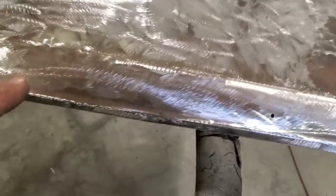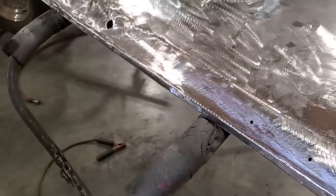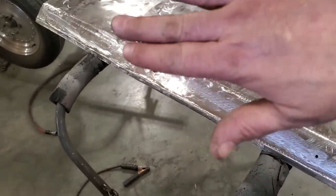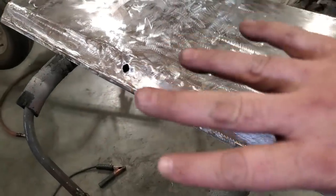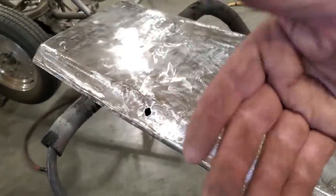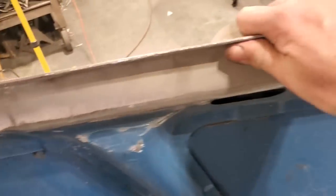So you know, just cutting the rust out of a car was never ever wise. It can help you in the long run. So repairs like this here, it's good, because I've done repairs, like I said before, where you cut it all out, and when you weld it all up, the best place to have it is on the car if you got to cut it out, because the problem you run into then is you don't know where the panel goes on the car, right? At least the way I did this here is I kept everything intact and I made the inner structure first, so that all went in place. So it's brand new there now, no rust at all in between the panels or anything like that. I'll get all this prepped in here now, and all that'll be cleaned up and painted later.